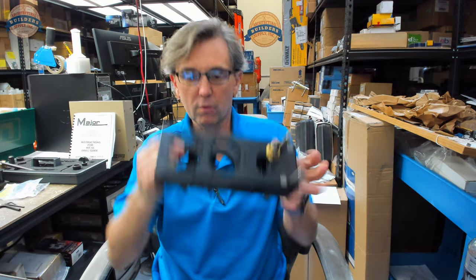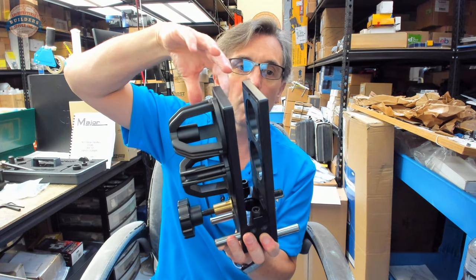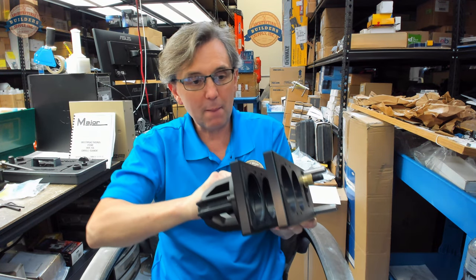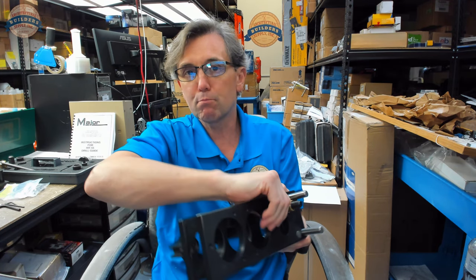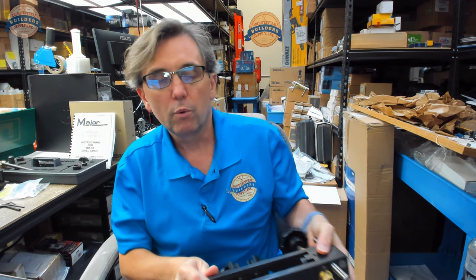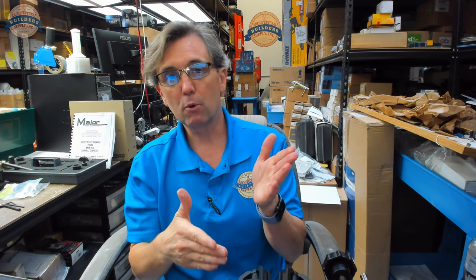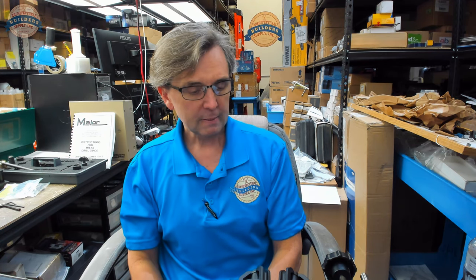So they have a rubber pad system that's here, okay? So as you go to clamp this down, you're not going to be leaving an impression mark. When we have tooling that we're clamping to a door, it's very normal for us to sand that aluminum or whatever it's made of down. Maybe put masking tape over it before you clamp it to the door. Because you may not see the marks that you'll leave until, quite frankly, it's a bit too late.